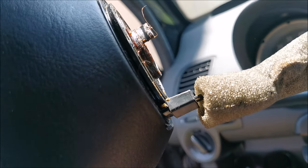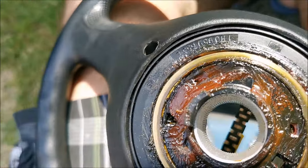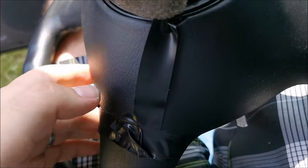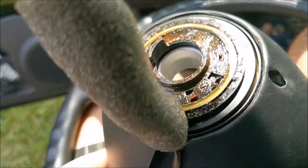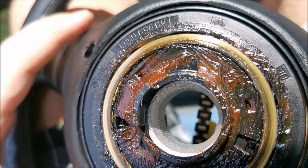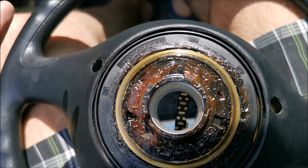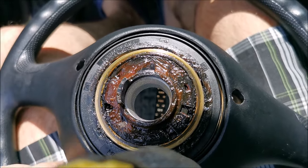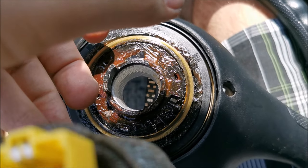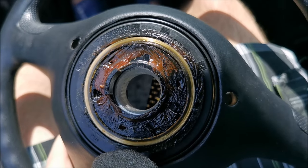This you want to make sure remains in the proper position. It actually has some kind of auto-lock — it doesn't rotate more than this by itself. What disengages the auto-lock — so maybe the position is more important when you install a new one. Make sure that you are in the middle with this, and you can rotate the same amount to the left and to the right, so you don't have a problem when you turn your wheel.